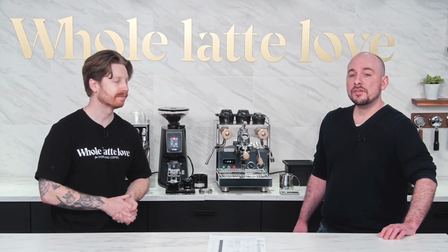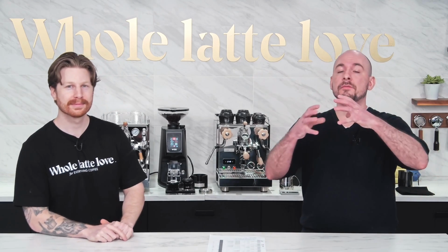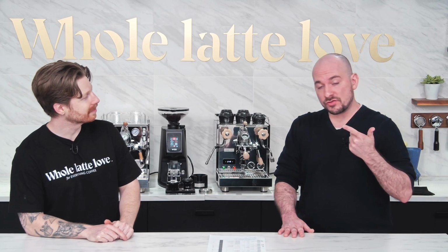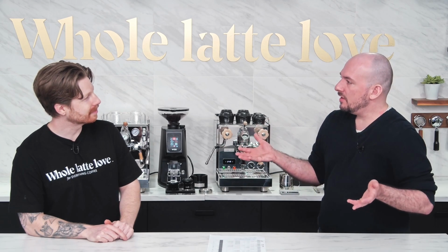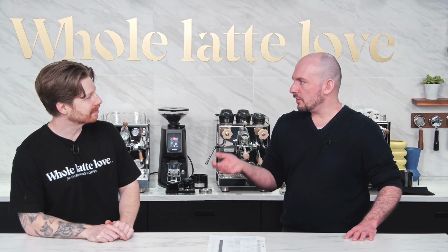That's right. So just to talk a little bit about how a heat exchanger works, you have a large boiler that's going to be supplying your hot water for your hot water wand and your steam for your steam wand. And then going through the center of that boiler is another tube connected to your brew group, and that's going to be full of your water that you'll use to brew your espresso.